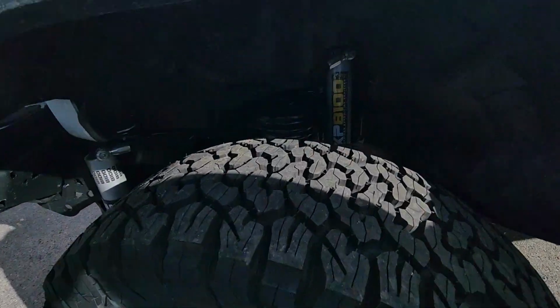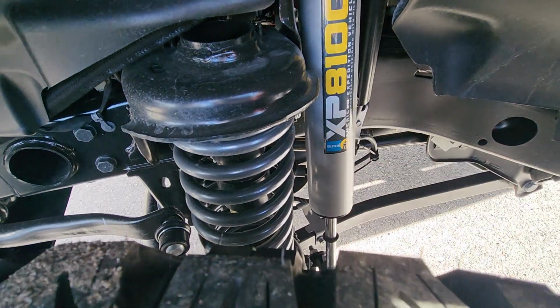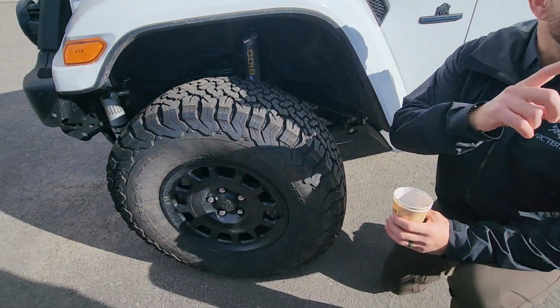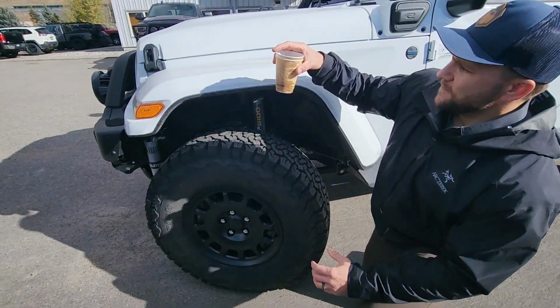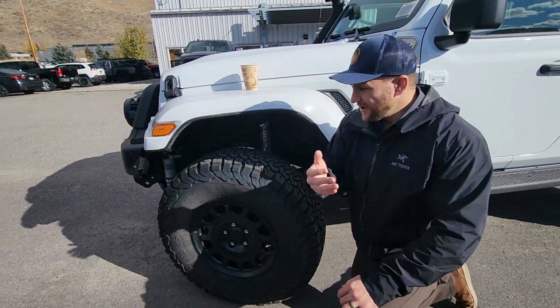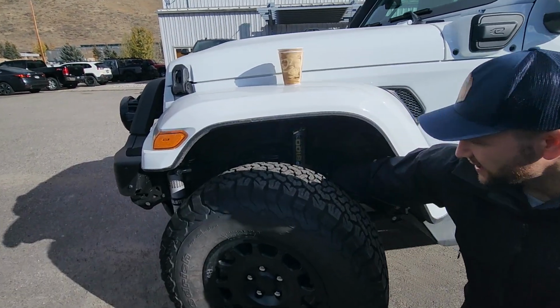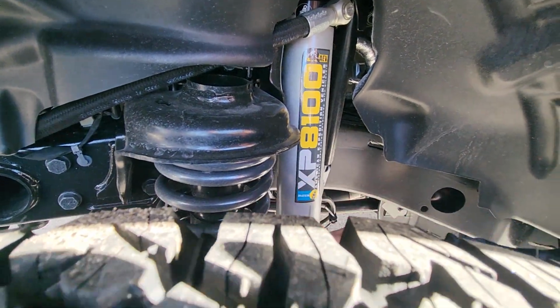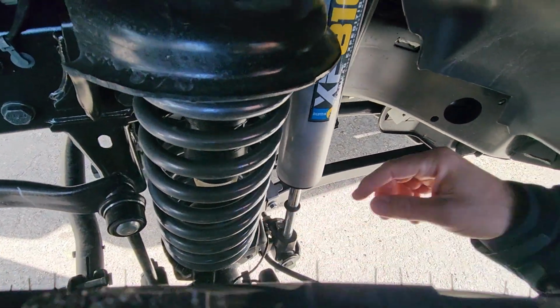when you're talking about the suspension, we'll talk about the spring first, okay? The two terms you want to remember are frequency tuned and triple rate, okay? Triple rate means it's literally got 3 spring rates, okay? If you look at the top of the spring, the coils are so close together, they're basically touching, right? And then you go further down the spring and they get progressively spaced out.